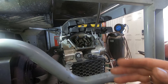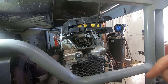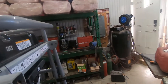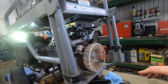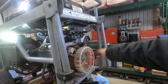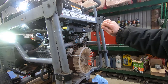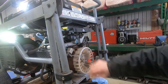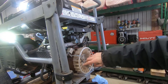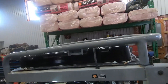The first thing you need to do is realize what rotation your engine goes — is it clockwise or counterclockwise? Right here we have a flywheel, and I didn't know whether the engine turned this way or that way. So I just bumped the key, just bumped it like that, and the engine spun in the clockwise direction. So I know the engine always spins clockwise, and for this whole procedure that's the way I'm going to spin this flywheel.